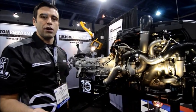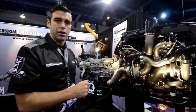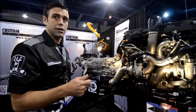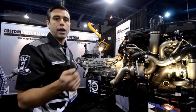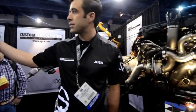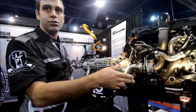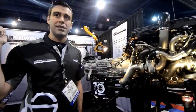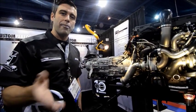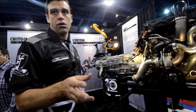Well, that's a loaded question. How much power do you want to throw at it? You're going to run out of fuel, but we have provisions for a manifold coming out with the sequential injector firing, or batch fire injector firing. Is there any way to address the fuel issues? Yes, and that's with the manifold or a fueling system that we're coming out with, as well as the in-tank pumps — our top hats that we utilize on the Mustangs to get the fuel from the back of the tank to the motor. That's the first key. The fuel system is separate.